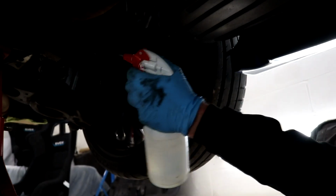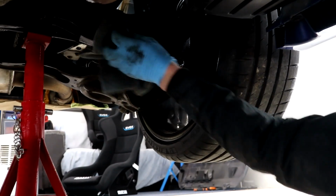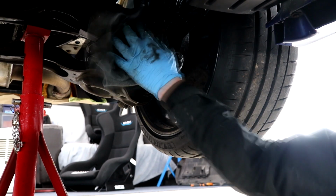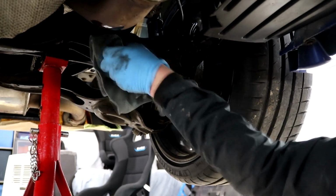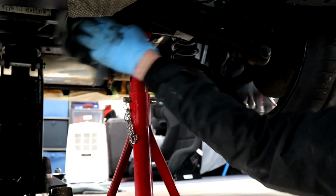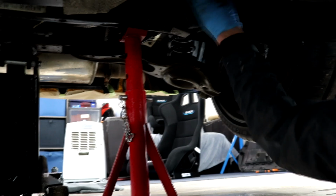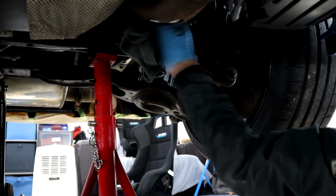We then proceeded to wipe the complete underside down with a substantial amount of IPA. Considering that this is the underside of the car that is more than likely receiving its first ever clean, it was very surprising to find that hardly any further dirt was coming off with what is essentially an incredibly strong degreaser. Please note the rear of the brake disc housing plates do need to come off for a complete refurbishment, which is why we didn't pay them any particular attention at this moment in time.